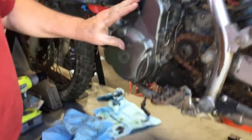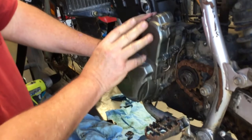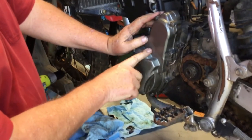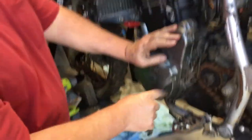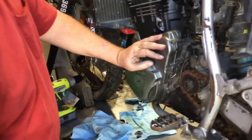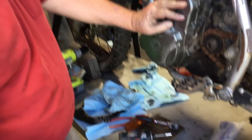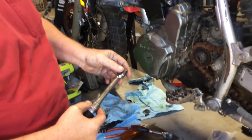And we didn't bother to torque the inner case bolts. Normally I would, 70 inch pounds, okay? And don't forget the small one that's back behind the gear. Now I would torque all of these 70 inch pounds, use a quarter inch torque wrench. Don't try to back off a half inch. Please don't. Again, don't use the bottom or top 10% of a torque wrench.